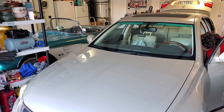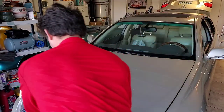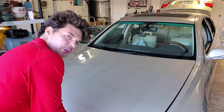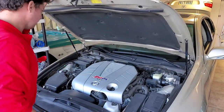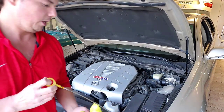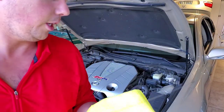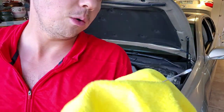We're going to motor down, pop our hood here. And we're going to show you what the oil looks like. So now it usually takes about 10 minutes for all the oil to drain down on a double overhead cam motor. So you're going to see it's going to be a little off here. But I want to just show you — this is a nice, fresh, virgin towel — and I want to show you what the oil looks like after one year.